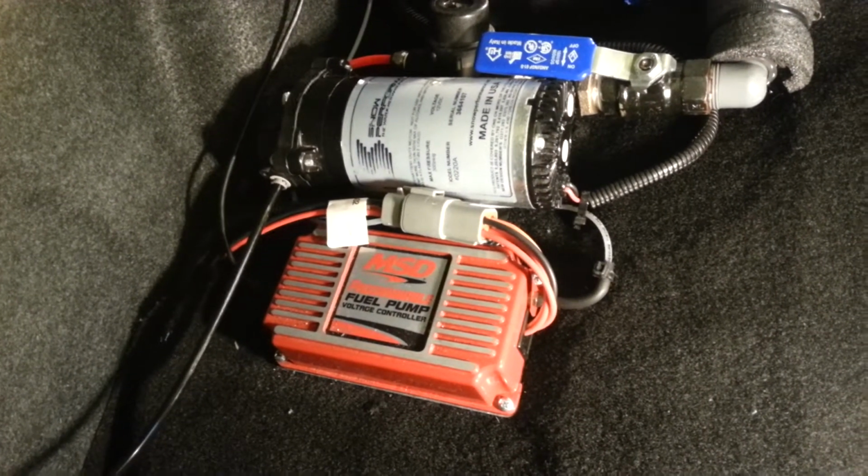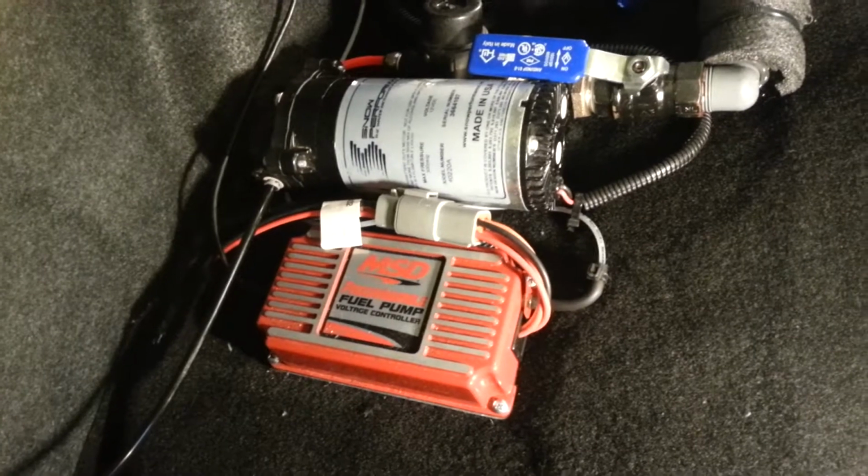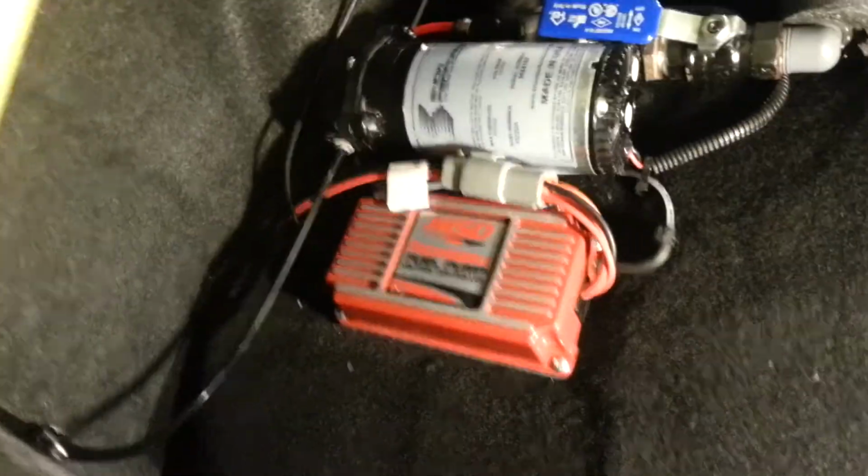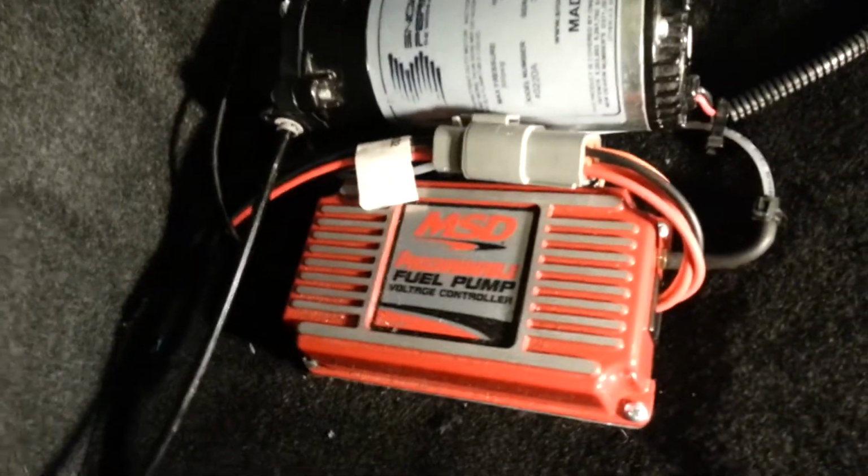2010 Camaro 2SS, installing MSD 2351 fuel enhancement unit. Mounted it in the trunk. There's a vacuum tube that runs underneath the back seats, under the left side driver's sill plate, through the firewall, and directly up to the supercharger on the pressure side.